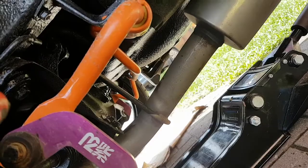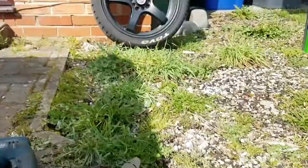Currently I'm just rubber malleting the hell out of my arches so these wheels don't scrub anymore. I've ground them back, similar to what I was doing the other day, hitting them with a heat gun a little bit, and just beating them out with a rubber mallet — which is great stress relief. Hopefully we won't get them rubbing anymore.